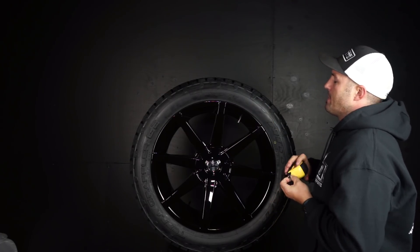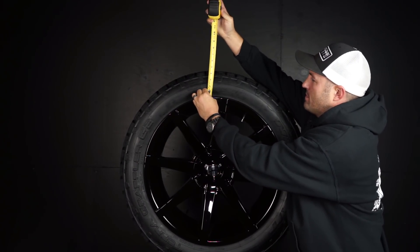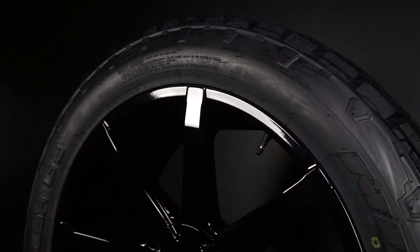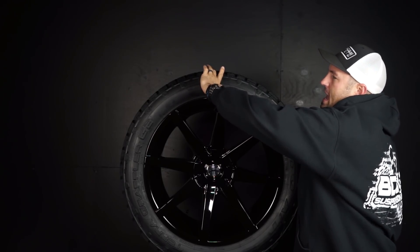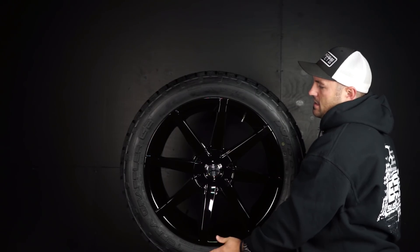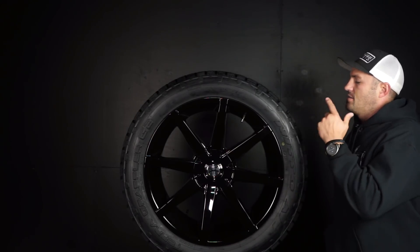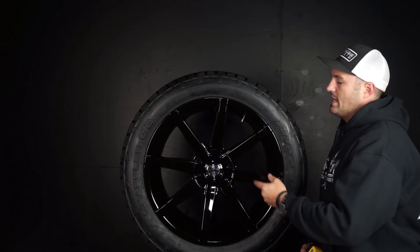The biggest reason is it's a 33 on a 22, so you don't have a ton of sidewall. The total sidewall from the top of that wheel to the top of that tread is only 4.5 inches, and to the tread line you're only at about 3.5 inches. So it's a low-profile setup, and that's why you don't have much bulge or protection for the wheel. But as long as you stay out of the curbs and the drive-throughs, you should be good to go. That is going to be your matchup on your 305/45 R22 on your 22 by 9.5.